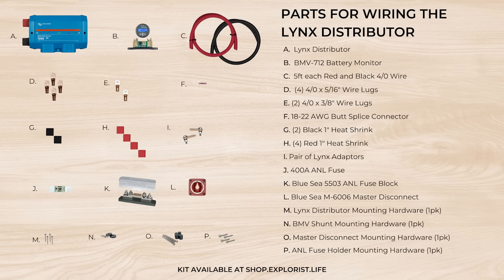Next, we're going to connect the wires to the Lynx distributor. First, make sure the master disconnect switch is off. Remove the separator, put the negative wire in place, replace the washer, lock washer, and nut, and snap the separator back into place. Put the mega fuse onto the positive bus bar, the positive wire onto the fuse, and replace the washers, lock washers, and nuts, and tighten. We can now turn our master battery switch on and turn on some of our DC loads around the camper and see that they work perfectly. We can also check the Victron Connect app and see the amperage used going up and down as we turn our lights on and off.